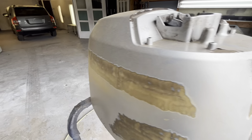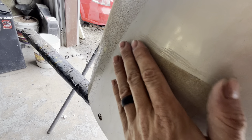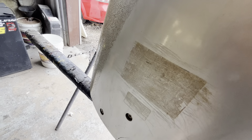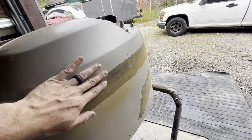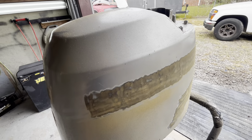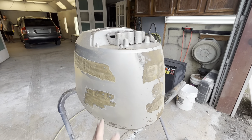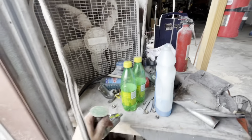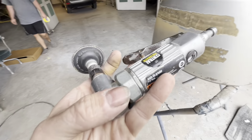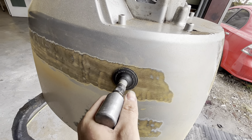Another method I've been doing for a while is taking a razor blade and just scratching it all up. You can see on the front right here I actually did a razor blade on this one — the glue is still on there but you can see where the razor blade scratched all the existing paint. But since it's all about how fast I can get these done — that's the only way it makes it worth the $200 — I said, well, how about we try a 90-degree grinder? I knew this was going to be a little aggressive. This is 36 grit on our 90-degree grinder.